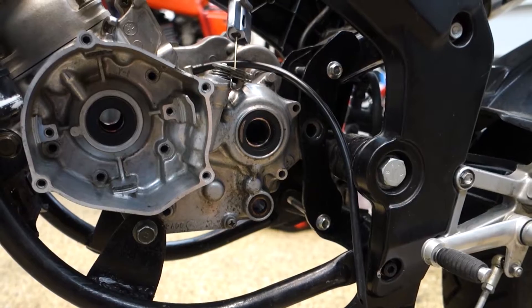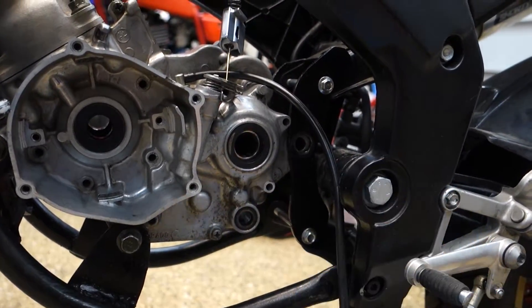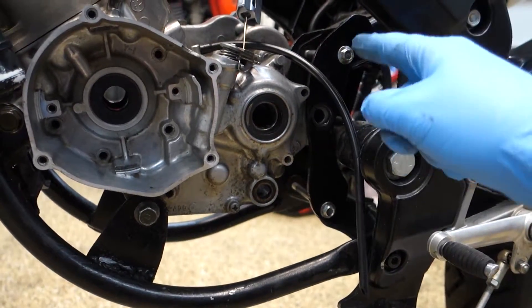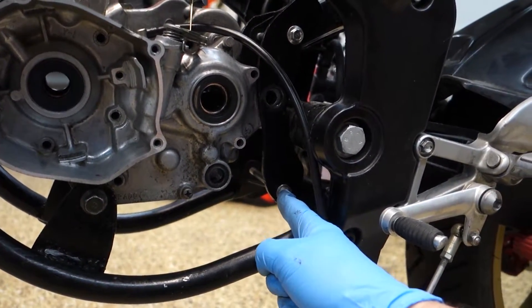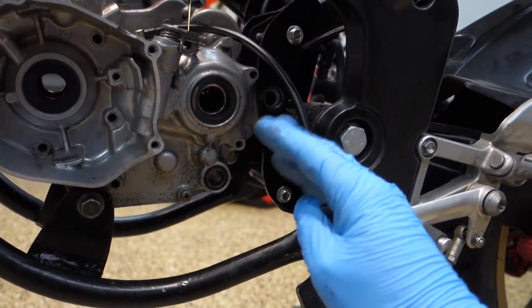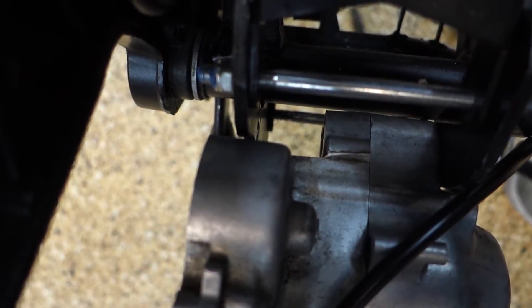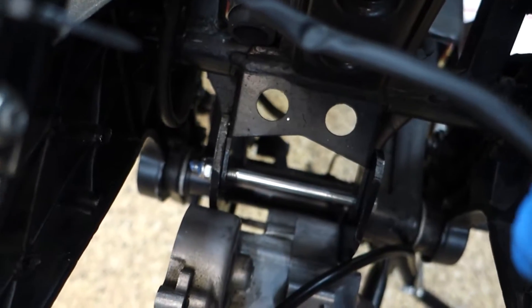Having it locked in here is good so I can create some spacers for this rear mounting cradle that I've kind of put together. I fabbed these two plates on the sides — there's one on each side — and then there's the stock bolts that go through here. These were the stock mounting points for the engine. But there's a gap between the engine cases and the plate, and the bolts don't have spacers between them to keep these plates from crushing in on each other.